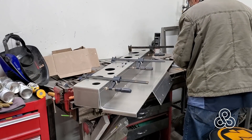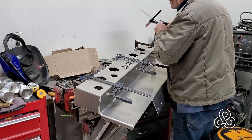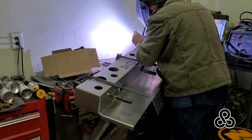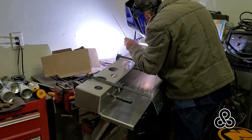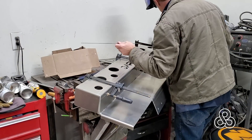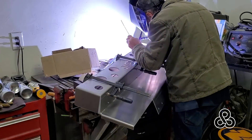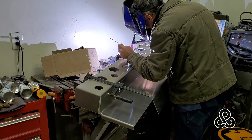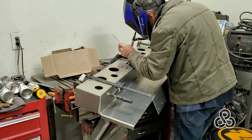You're going to see later on that after we did some trial fitting, there's a little bit of a curve in the rear clamshell that interferes with the ends of this box and we had to trim those corners out. Right now you'll see a complete box structure, but later you'll see little corner triangles missing — which actually turned out kind of nice. One of the holes lines up with some mounting holes on the bottom, and once the corners are gone it was much easier to get a tool in there to set the nuts, and it looks nice as well.